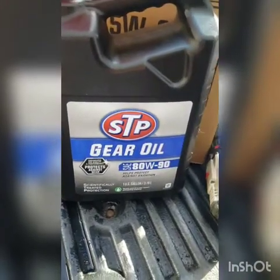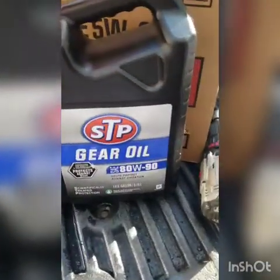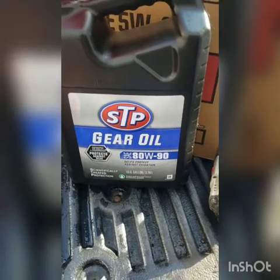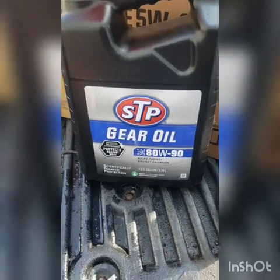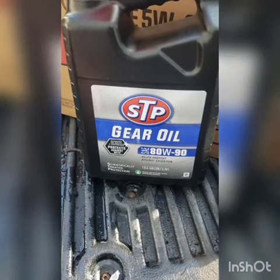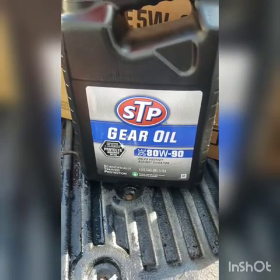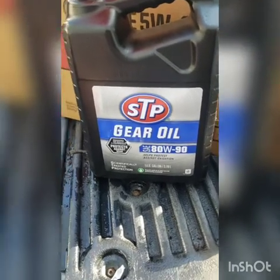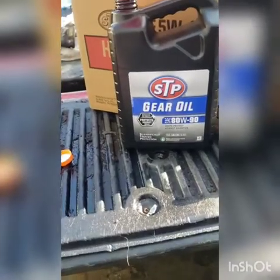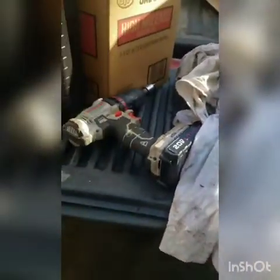Finally filled it up - it actually took a gallon, four quarts, almost. There's a little bit left in the bottom. You're supposed to just fill it until it comes out of the fill port, and that's what I did - four quarts. That concludes it. Just keep an eye on it, make sure it's not leaking from the seal. So that was a rear differential pan for a Dana 60 on a 2003 Ford F-250 5.4 four-wheel drive. If you're curious how much fluid it holds, buy a gallon. I would say you probably don't have to buy the gasket - RTV would work. They had the gasket for $7, so that's why I bought it, but next time around you don't have to. That's up to you.